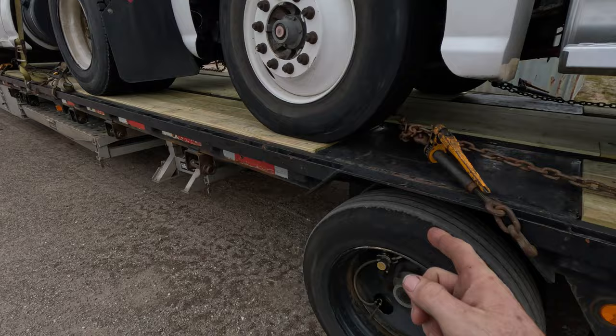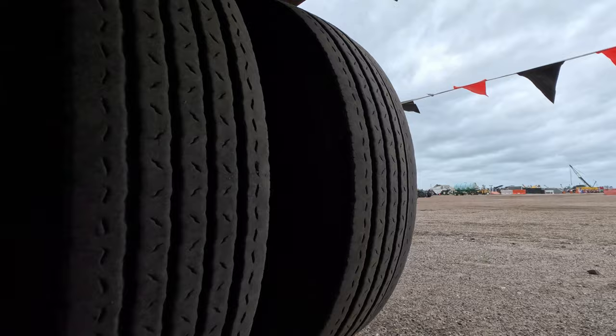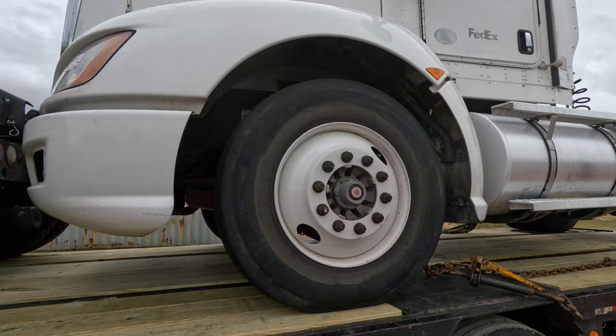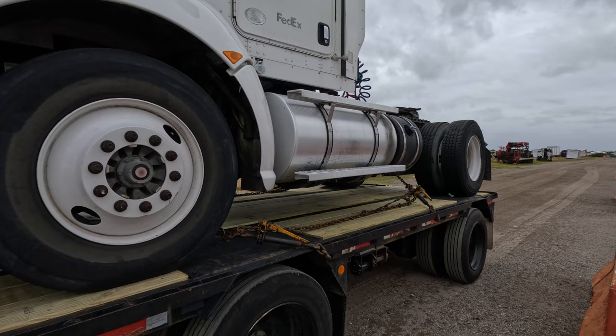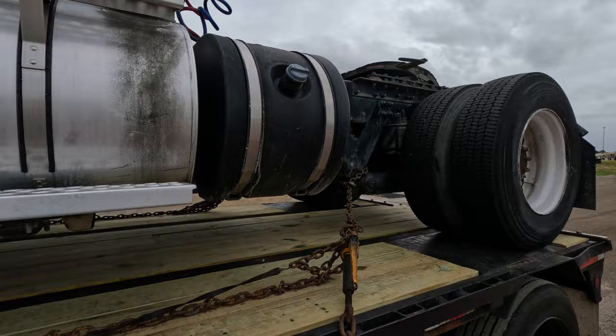If I ever told you guys, I've got the dump valve, obviously, for this axle in the truck. But I put a hand valve in here to dump these airbags, both airbags, to make loading and unloading a little easier. So that'll drain both sets of airbags, which keep the trailer from rocking back and forth, because the trailer will be sitting on the tires when you're loading and unloading, and puts it down lower for the ramps. So looks like it's gonna rain, so we gotta hustle.